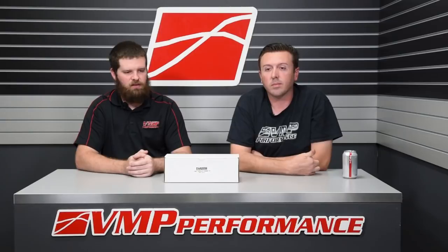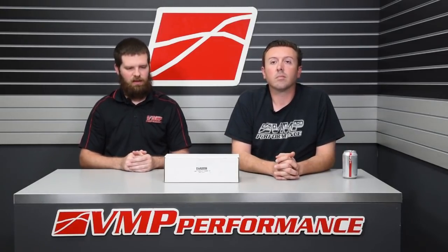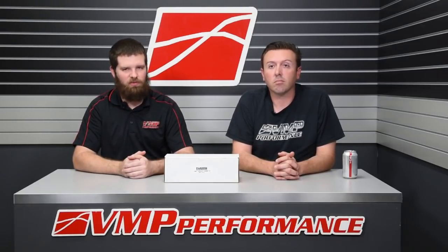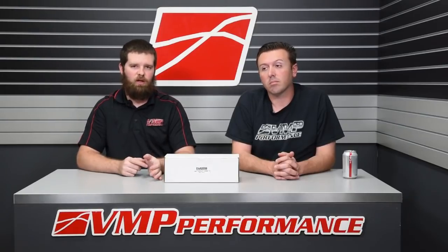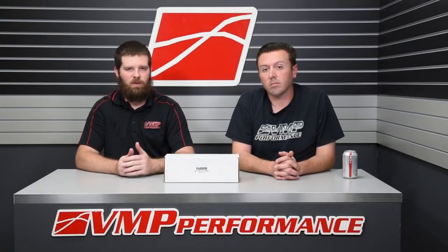But I don't know. I'd start with a tune. If you have a high quality fuel or a high octane fuel like E85 or race gas locally, I'd say that's the shortest route to the best possible performance out of the setup of the car. And then just kind of work from there. Like you alluded to, the factory cold air does perform well, but we have seen verifiable dyno results from some of the aftermarket cold airs out there. They do make more power, but if you're not out there using all of that power all the time, sometimes stuff like that doesn't make sense. So you've got to look at pros and cons, check stuff off your list, and see what's going to be worth it and best for you.